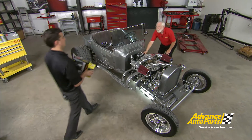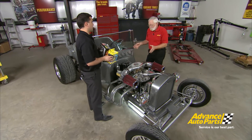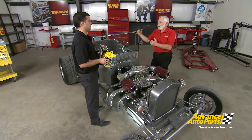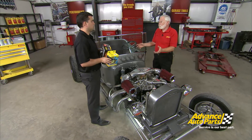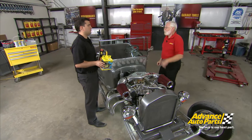Hey Jim, hey Chris — look what I brought you. This little T-bucket roadster has some ignition issues. It's basically running out of spark in the mid to high RPM range, and we're thinking an HEI coil will take care of that and we'll go from there. Put that stuff on the workbench and let's get started.